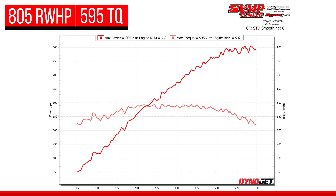That was 188 degrees Fahrenheit engine coolant temp. As Justin had said before, that's Boostane 93 octane, still very moderate timing — about 17.5 to 18 degrees of timing.